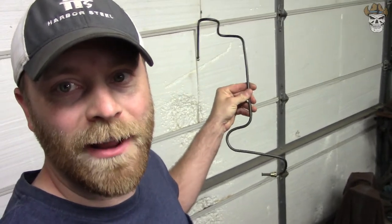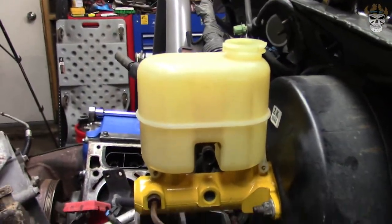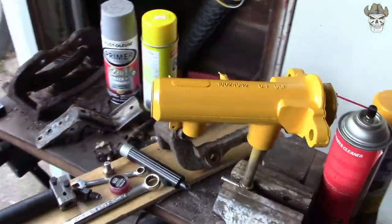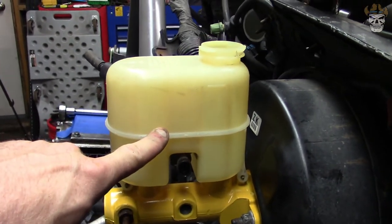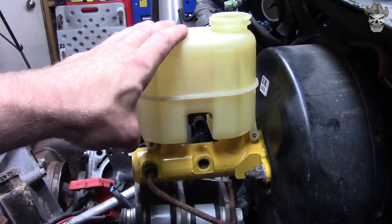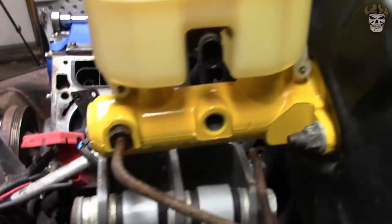I'm pretty proud of this line, and that flare tool made six perfect flares — I'm glad I invested in it. Before doing this I cleaned the reservoir out, since now was a good time. When removing the reservoir, sand got down into the o-ring seal area, so I removed the master cylinder, cleaned it all up, and painted it. For the reservoir itself, I tried soap and hot water but nothing was working. What ultimately worked was Scrubbing Bubbles shower cleaner — I sprayed it in the top and bottom and it worked almost instantaneously. Then I heated it in the oven for a bit to make sure all the water was out. Now we take this line from the tee up to the master cylinder.